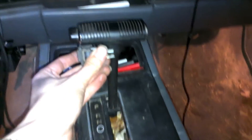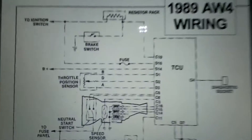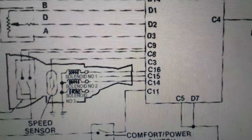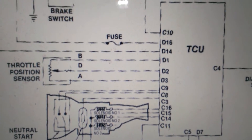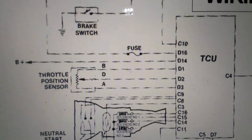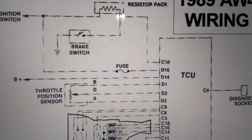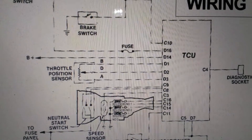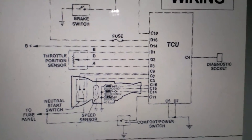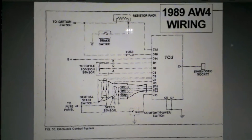And the way this is all set up, I think I'm going to mount my switch somewhere right about there. I don't know if I want it flat or like this, but it feels very comfortable in that position. So if we come in over here — C15 controls solenoid 2, that's the one that we care about — we're just trying to feed a positive signal to that. And if you go up here, you have two different positives: D14, which goes directly to the battery, and D16, which is a fused link that's also connected to the ignition. And the reason we're taking D16 is, one, for the fuse, and two, we don't really need our switch to work if the engine isn't running. You wouldn't want to flip that switch and have your transmission do things while the car is off.